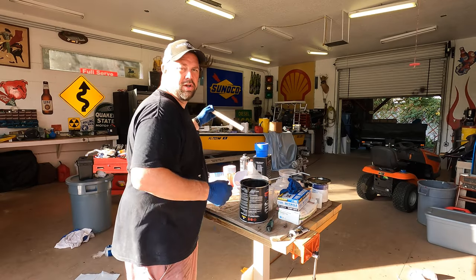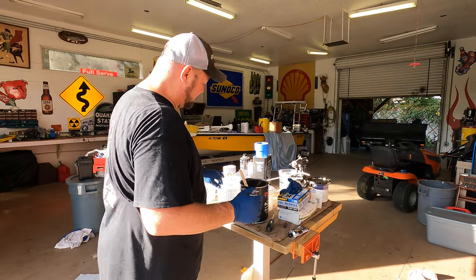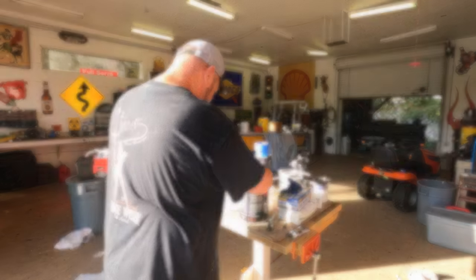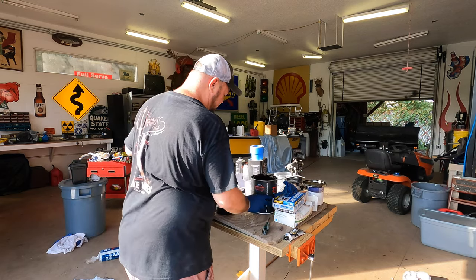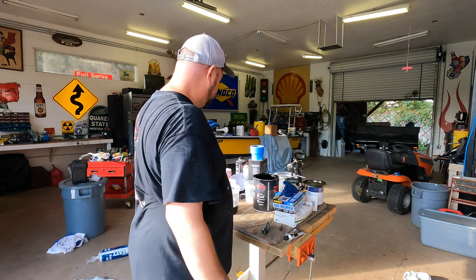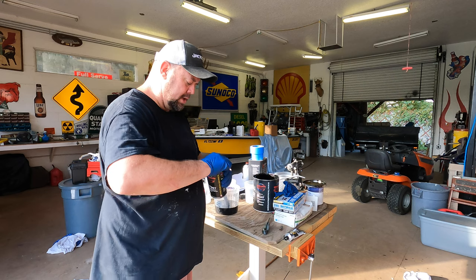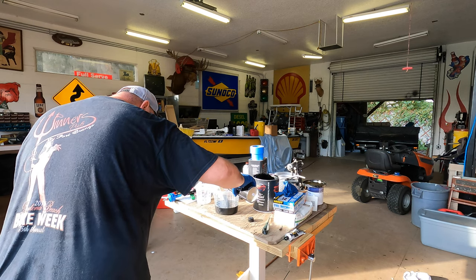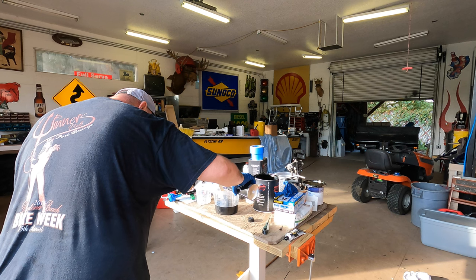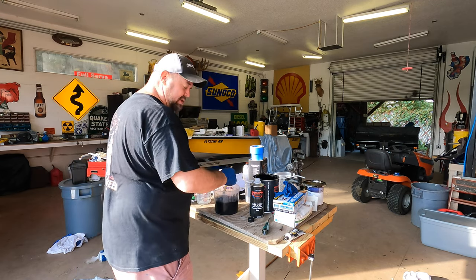With any paint, you wanna stir it up real good before you start mixing. So I'm gonna mix up 1 quart right now and then we'll start with that for the first coat. So I did 24 ounces of paint. And I'm gonna do 8 ounces of the hardener. Yep, 8 ounces of the hardener. I use slow because we're in a hotter climate. Slow hardener, no reducer this time. Put it right up to 32. Mix this thoroughly.